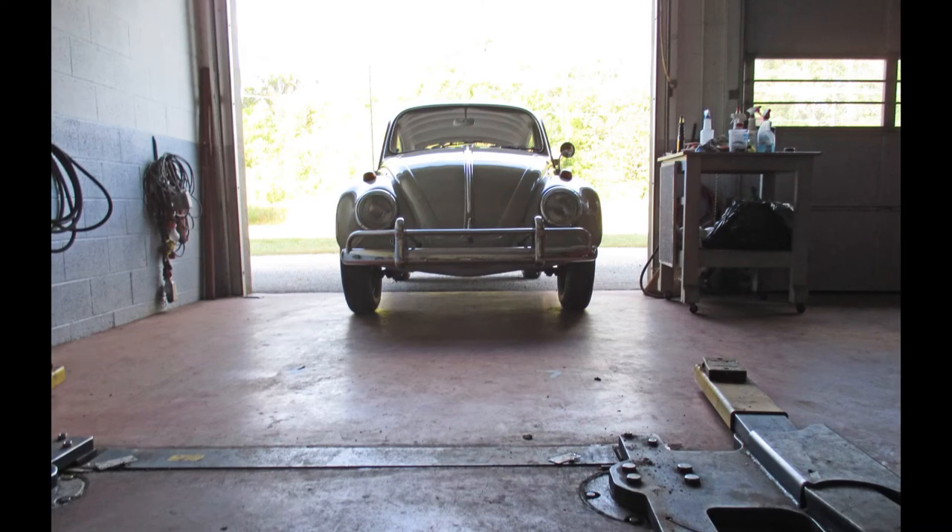So now I've pretty well covered my way of lining up the front and rear. The front is aligned just like the rear, only the front has to have one-eighth inch toe in, not toe out. And to adjust that, you loosen the tie rods and turn them one way or the other until you get your measurements right. Squaring my front end and rear end with each other and having the proper alignment did take care of this driving-on-ice feeling.